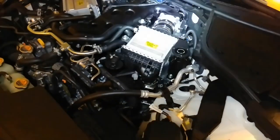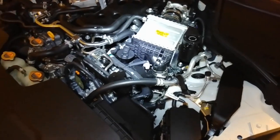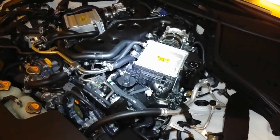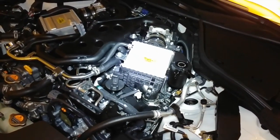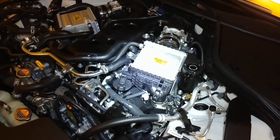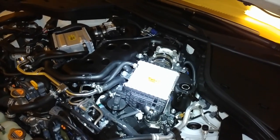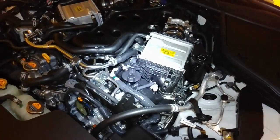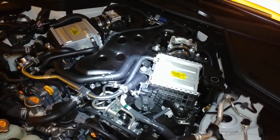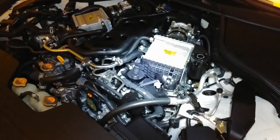I had a 2013 or 2014 Ford Focus ST and I didn't have a catch can on there until maybe 12,000 to 14,000 miles. I ended up adding some intake plumbing and turbo plumbing, so I had the intake off. That allowed me to see right into the intake valves, and they were just coated with carbon — just nasty. It was a pain to clean. I did it by hand, cleaned them up, then got the catch can and added that.